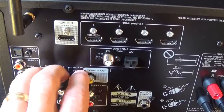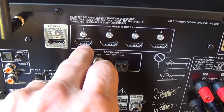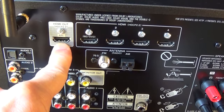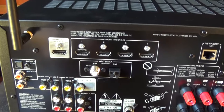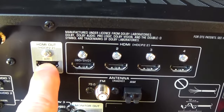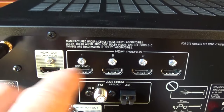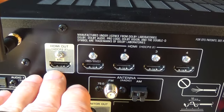The simplest way to connect your receiver to your TV is to connect all your AV devices — like your Xfinity, Blu-ray player, PS3, etc. — into your receiver and then output the signals to your TV. That's how older receivers worked. However, today you have more choice. The newest receivers can communicate back and forth from your TV to your receiver through this HDMI ARC connection. This is the HDMI out, so all signals go out, but the ARC connection can also input audio signals from your TV, and your TV can control your receiver to a certain extent.